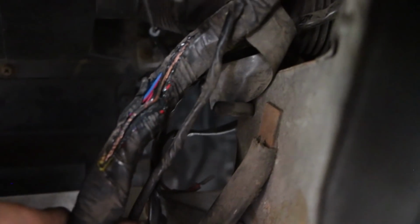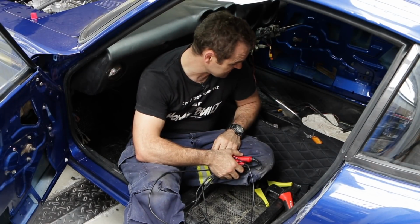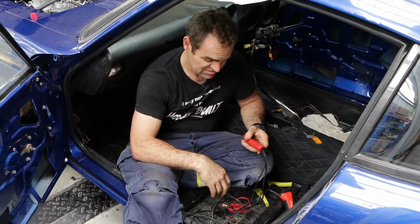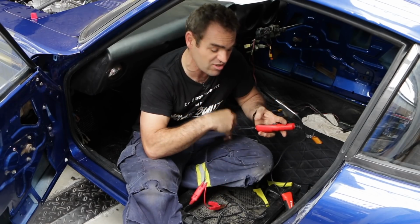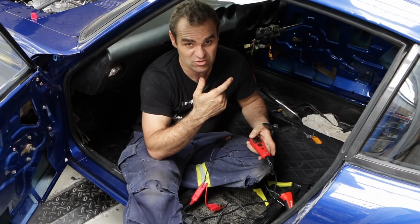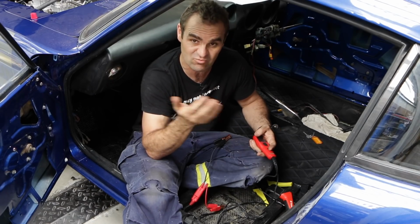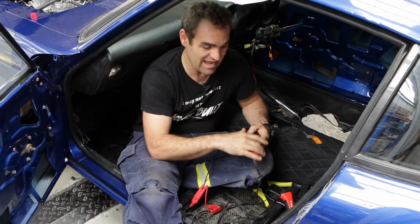Look at that. You can see it's melted all the way through there. Great. I did say that I hated wiring, but unfortunately it's a setback I really didn't want to have to deal with. But the only way is to move forward, so that means getting out my power scanner and going through to see if I can work out what circuit is what, starting with checking that cooked wire and seeing if I can trace it into the engine bay and find out what wire it actually is and what's not working. At least that much I can try and gather something from.